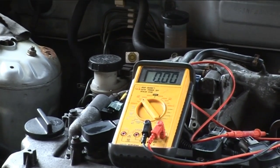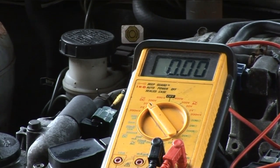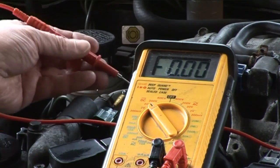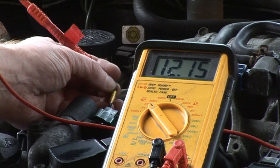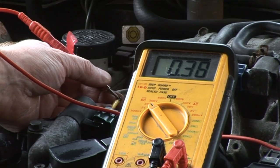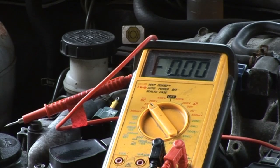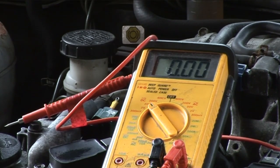I'm under the bonnet now. Here's the location of the variable valve timing solenoid right there. I have a pin-back probe in the main feed to it and I'm just going to check the voltage. Okay, we have 12 volts. I'm going to check the ground side — switched — zero volts there. You should have 12 volts on both sides of that solenoid with the key on and engine off. I think now there's an open circuit in the solenoid. I'm going to get the connector off and do an ohms test on the two pins of the solenoid.